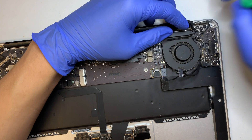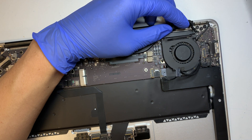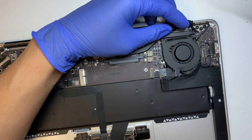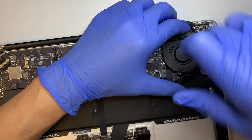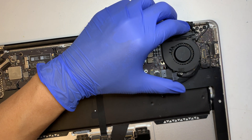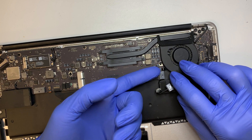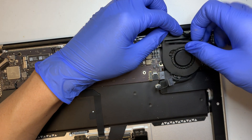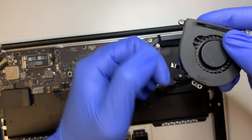At this point, I'll leave the rubber for the CPU fan aside. We're going to remove the fan now. There are three screws holding the fan. Once you remove those, open the clipper by flipping it up with your fingernail — you can see this tiny little clipper. Then the cable comes right out. Gently slide out this CPU fan cable.